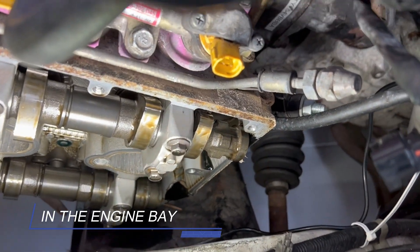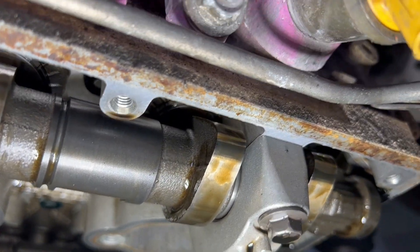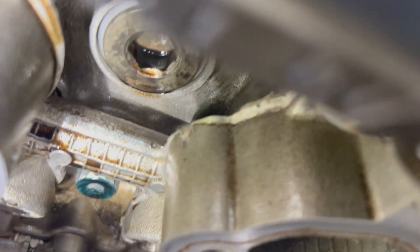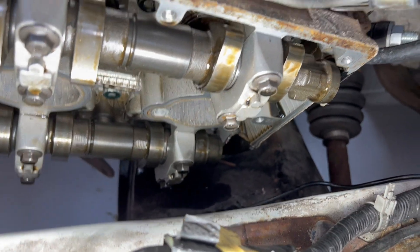This is kind of what I was worried about — but I'm not missing any valve shims. You can see that one's in place, that one's in place, you can just see it down there. The bottom ones are a little easier to see, and the bottom ones are all in place. Now I'll check the clearances.